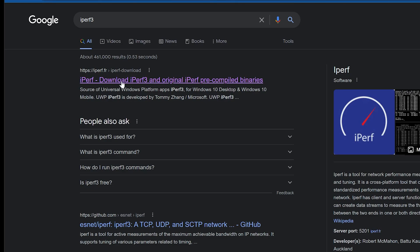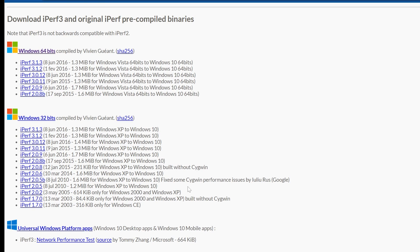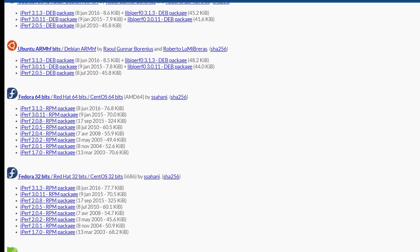I missed a step I need to go back and share. Let's search for iperf3 and go to iperf.fr. From there you can download the individual client for your platform — whether it's Windows 64-bit, 32-bit, Android, Apple iOS, Ubuntu, Fedora — they've got a ton of different options to download the client side, like what we looked at on my PC, to then communicate with the server side. I'll leave a link to this in the description below. That's how easy it is to get an iPerf server up and running and then communicate with that server to do the testing and make sure you're getting all of the bandwidth out of your device.